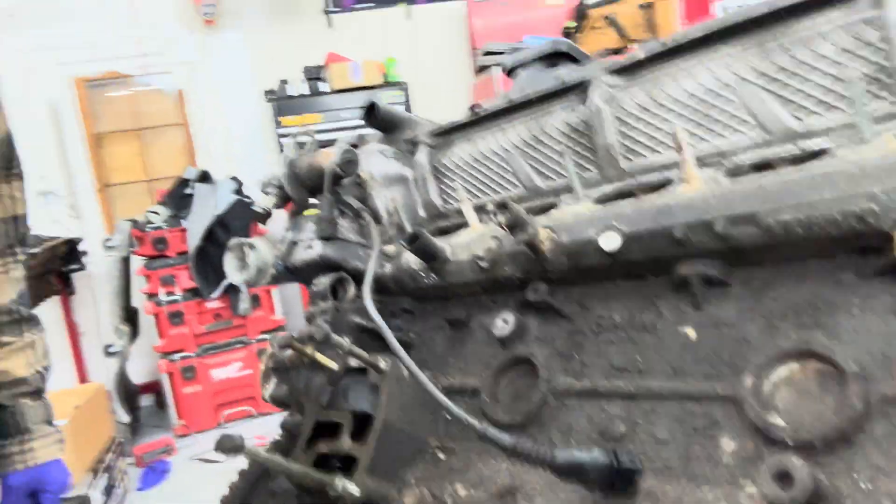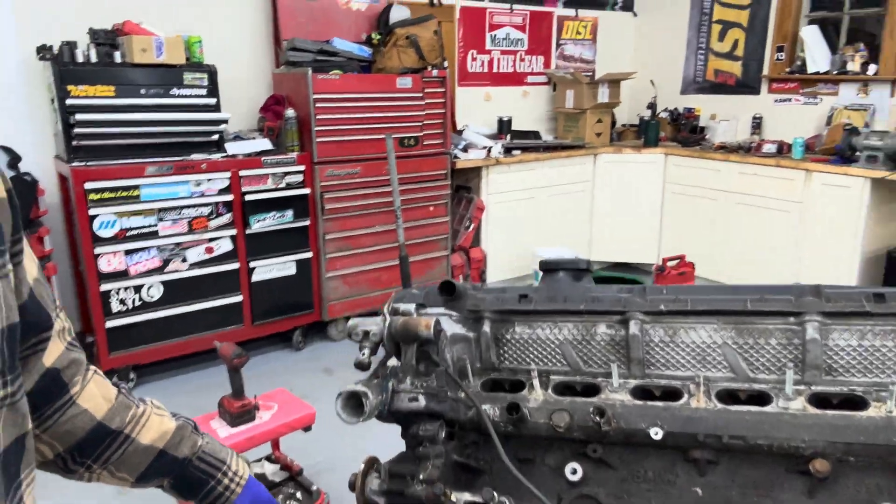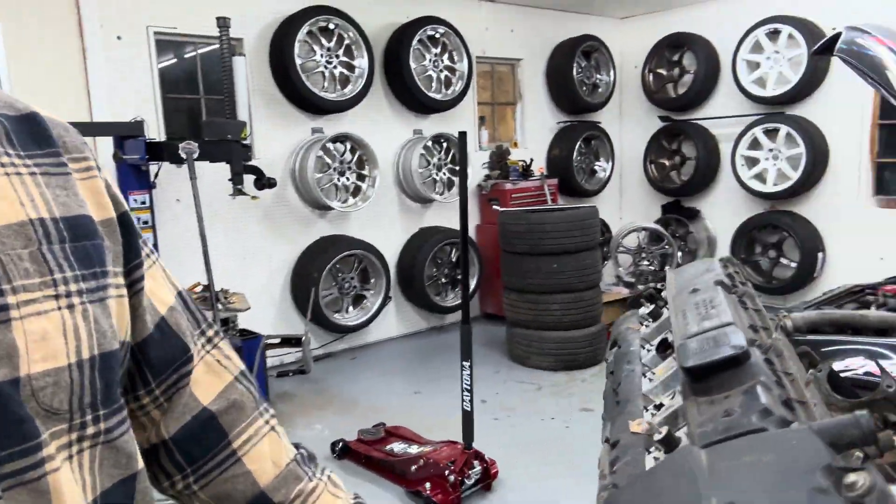So we're going all out on this motor. I'm excited — it's expensive, but hopefully it pays off. I'll do a quick teardown. This is an E36 motor with 200-something thousand miles. It's absolutely filthy, but I need to pull the head off, pull the accessories — which are basically off — pull the pan, valve cover, harmonic balancer, and get it down to basically just the short block: crank, block itself, all the pistons and rods need to come out.